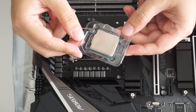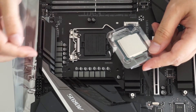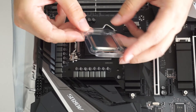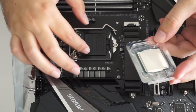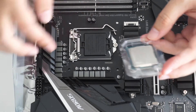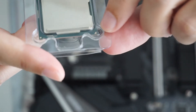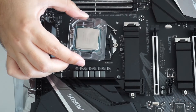So just open the box from the i9 and also open this brand new motherboard, and we're going to place it into this slot here. The only thing we have to be careful about is when we open this — there is a plastic protector that is supposed to be taken off, and you need to save it in case you need to bring back your motherboard or disassemble it. The chip will go inside there once this lever is disconnected. To guide us, there is a tiny arrow and also two notches on the top, so it's supposed to go according to those guidelines.